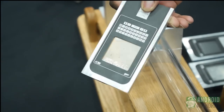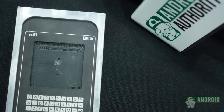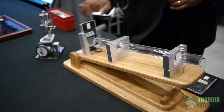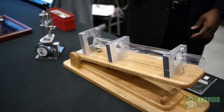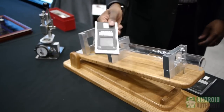That's the competitor glass with the 7-newton scratch. So this is Gorilla Glass 3 with the same 7-newton scratch and same thickness. Load it in the tester, give it a pull. You see Gorilla 3 — still intact. No problem with the Gorilla 3.